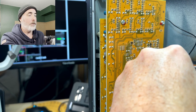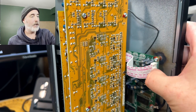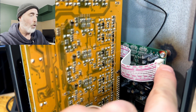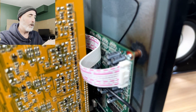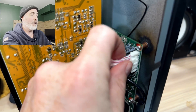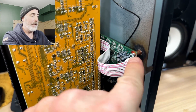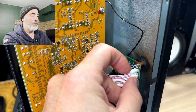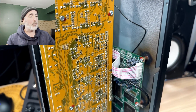If this is indeed your problem, you're just going to seat it back in there and push down until you hear it click into place. Hopefully you heard that little click. Now you can see that this latching mechanism is over top of the piece that holds it in place underneath. You'll know it's seated if you try to move it and you don't see the plastic insert moving around — the cable itself may move, but the insert is not — and you cannot easily pull it out. You would have to press on the front of the clip so it pops up. Have a quick look, make sure your ribbon cable is attached.